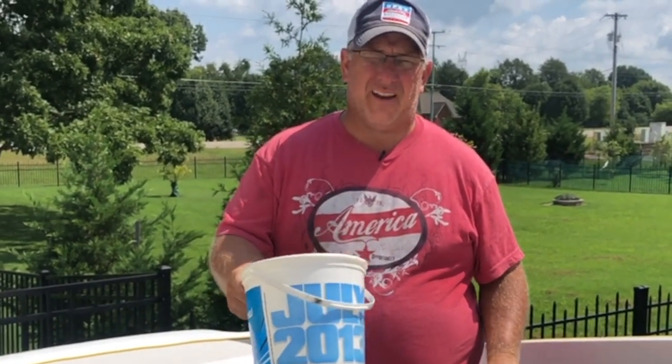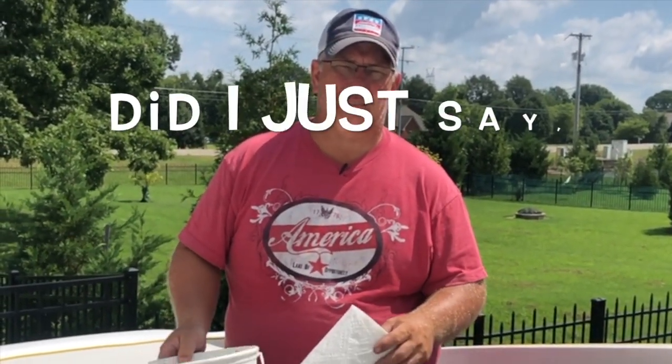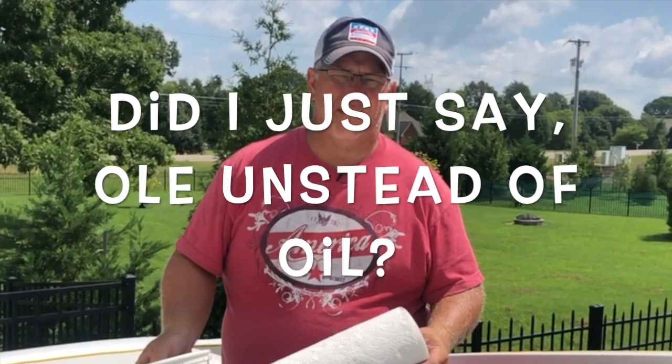You can see I'm in the motor compartment and we're getting ready to take the oil filter out. I try to always use the bucket, and you're probably going to want a few paper towels because it's going to make a little bit of a mess. Right now the oil is not draining real fast because it's still a closed system. So we're going to loosen up the oil filter and let some air into it — that'll actually drain the oil faster. Then we'll go back to putting it together.